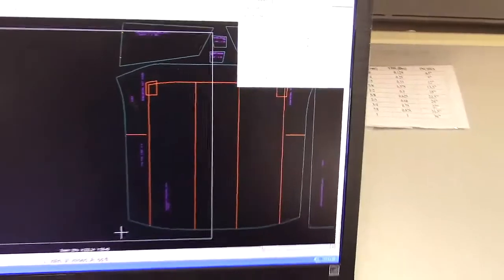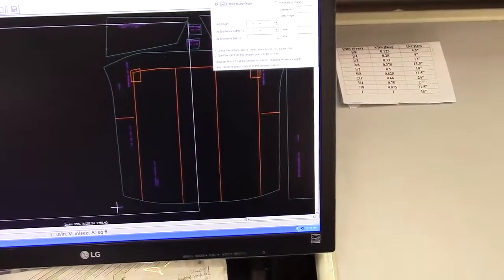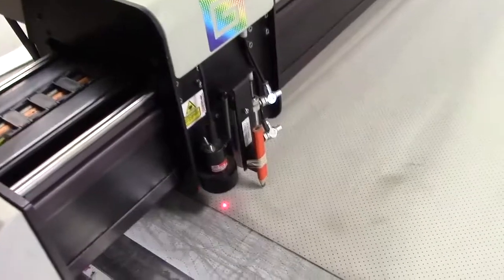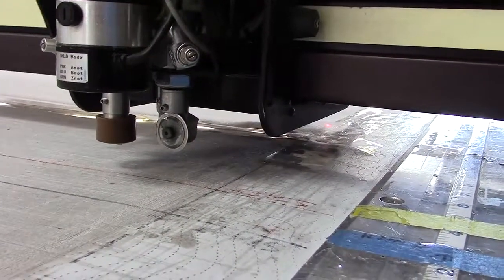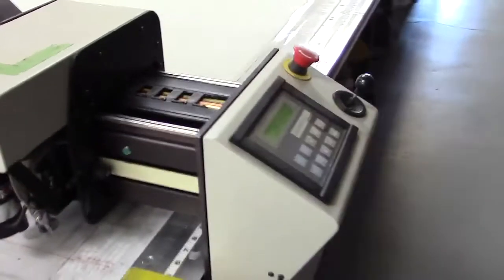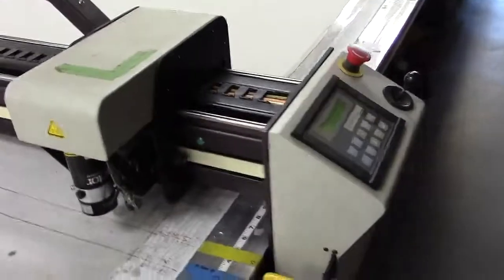We're going to wet the back of the material so it lubricates the pencil and makes sure the pencil works well. Then the next step is going to be the notching. We actually use bottled water so there's no staining of the material. We have a soft-lead carpenter's pencil. The machine's going to cut that. Once we've done the notching and the pencil work, we will then cut the outside in a separate stage. Looking at the cutting wheel, which is an Olfa knife blade, and then below the notch-in — that's the brown thing. It's like a chisel, very sharp, about six millimeters wide, and it just hammers down and cuts a little line-up mark in the material. We're going to turn on the vacuum — with the perforated headliner it doesn't work as well, so we've used some tape in addition.